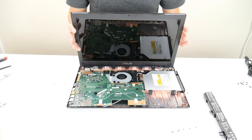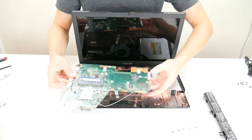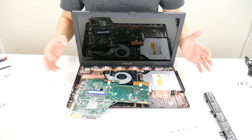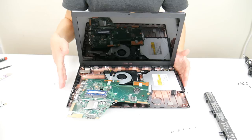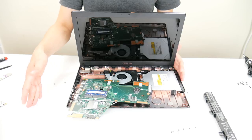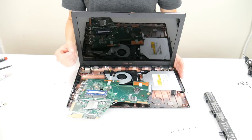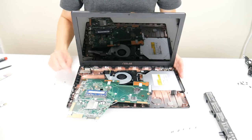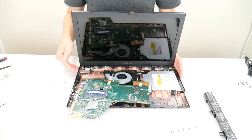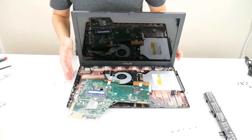However, if this has not worked and your computer is still not turning on, that could mean a number of things. It could mean your actual CMOS battery is bad and needs to be replaced, which is a pretty cheap fix — try that first. It could also mean there are other components not working correctly. Check video three in the description to test your power jack and make sure it's delivering the correct electricity, and video four to confirm the power jack is getting the correct voltage from the charger all the way to your motherboard.